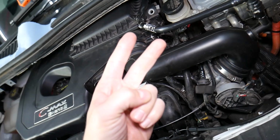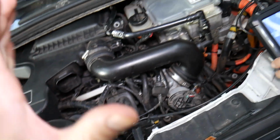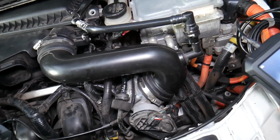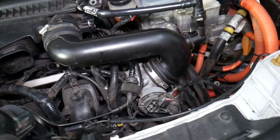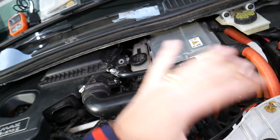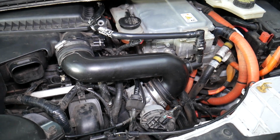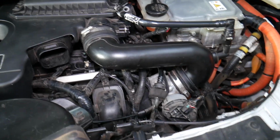Number two will be a broken vacuum pump. Most of the engines, especially hybrids, and most of them nowadays will have electric vacuum pumps. As a result, if the car dies or something like that, when the engine turns off, it can still produce vacuum, so you're not going to lose your brakes and crash. Number three, bad booster. This is the least common. Not very common to have a bad booster, by the way. Having actually a broken vacuum line or vacuum pump will be number one.